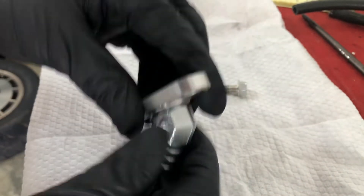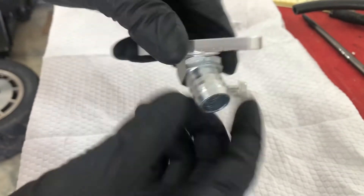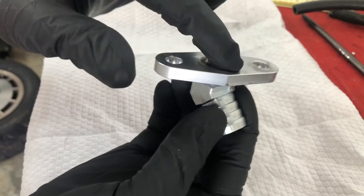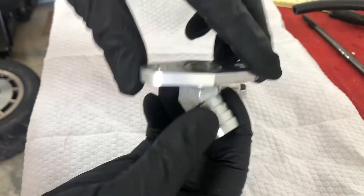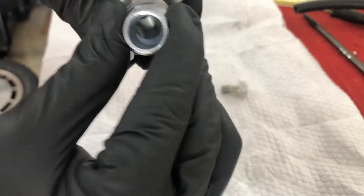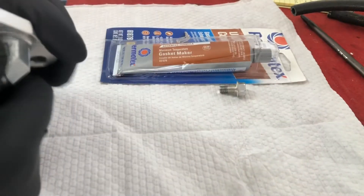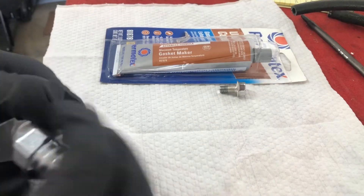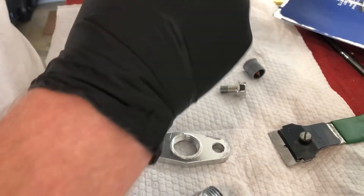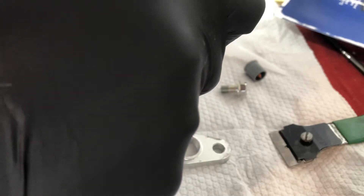We have our modified eBay oil drain flange with a 45-degree elbow — that's about finger-tight right there. I cleaned up the top of this so it wouldn't touch or interfere with the bottom of the turbo. I'll probably need to tighten it a few more degrees to seal it. I am going to use some of this copper gasket maker — I'm just gonna smear it all over the threads.